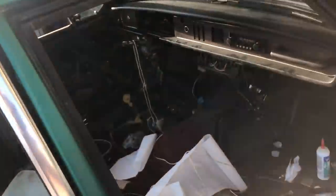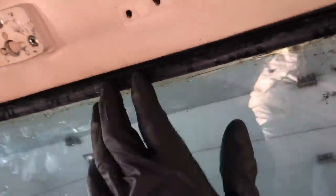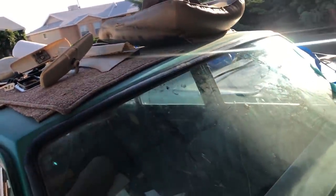Lots of force — pushing down, pushing down, pushing down. I don't know how to quantify how many pounds of force, but it's really just gentle, gentle, gentle, because I didn't want it to break. Nobody wants their windshield to break. I was thinking: am I prepared to spend a month's wages on getting a replacement or not? So the seal worked its way around with a little bit of silicone spray, some patience — a lot of patience. A little ingenuity. The way I did it is I used the gap in the tool to put the straw from the silicone spray, and worked them both around. I didn't film because I was in the heat of the moment, but eventually that helped the inside slide a little bit better.